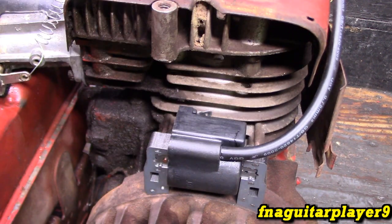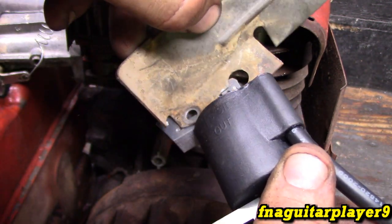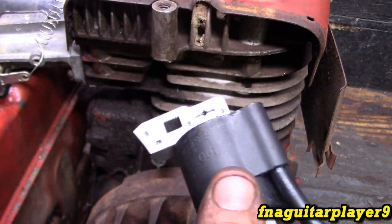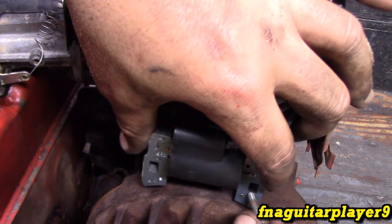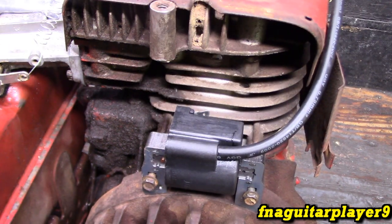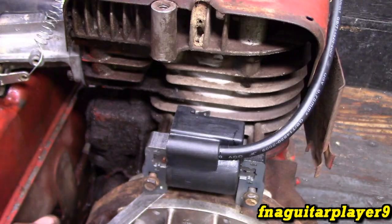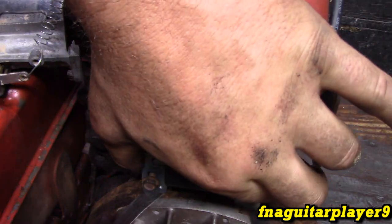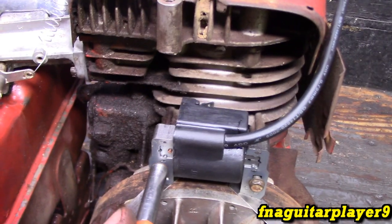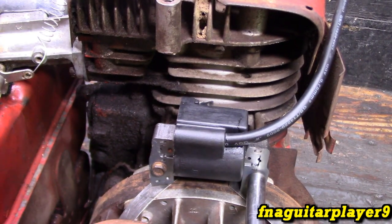You've got your two bolts that go in here. Another problem with these aftermarket ones is there's really no way to put the shield on there — if you just have one bolt holding it, it could work loose. So if you really want it on there, you might want to bend that tab around or cut it and wrap it around to hold it somehow. Most people just do away with it — all it does is direct more air towards the valves anyway. You need two feeler gauges or a business card — spin it around until your magnet gets up here, right in the middle. These are 10 thousandths — that's what I set all coils at. Never had any problems out of a coil set at 10 thousandths. It's a good all-around setting. Briggs calls for 10 to 14 thousandths. Snug these up — don't go real crazy because you're just going into aluminum and it will strip.